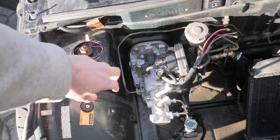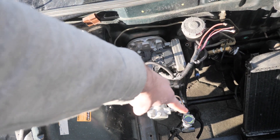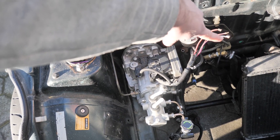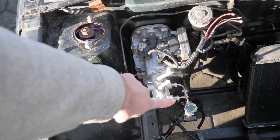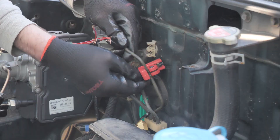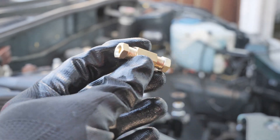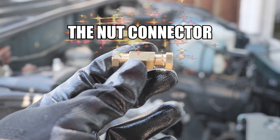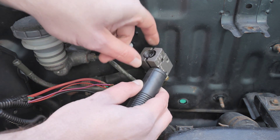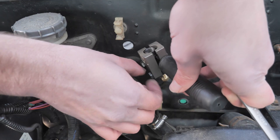So originally all the brake lines came to this side, and so this is the rear. I'm going to start with this one. Now I have to make it come from there and around to this side, so I'm going to cut this right in the middle somewhere, probably over there, and then have another brake line that comes and connects to the proportioning valve. Now we enter the point of no return, but at least I was wearing gloves. I ordered this Chinese finger-trap looking thing that joins two tubes together — I will call it the nut connector because I'm a child. Flare nut union is the official term. This is my first time flaring a tube inside the car, and I felt like I did a pretty good job. I mean, there aren't really pretty good jobs — it's either you do it right or it leaks.